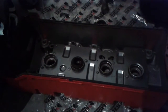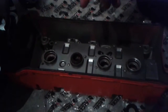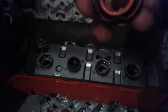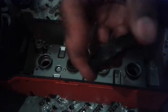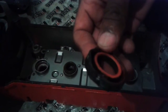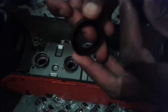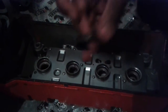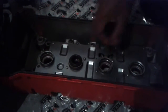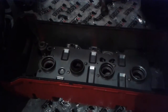That's it, it's done — it's that simple. The reason I've made this video is because I couldn't find anything on YouTube showing how to take them out. The old seal almost feels like it's compressed in there — you can see a bit of metal, and that metal is the same as on the new one. When you order these, they're exactly the same and really hard on the edge because there's a piece of metal in there. So you've got to somehow compress these in — best thing is just tap it with a nylon or rubber mallet and that'll get it in.